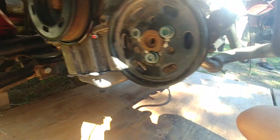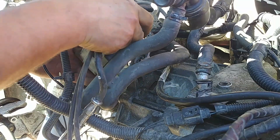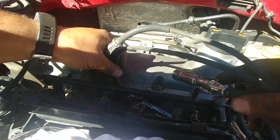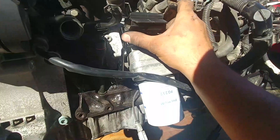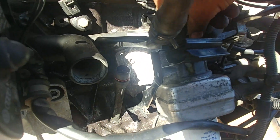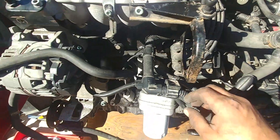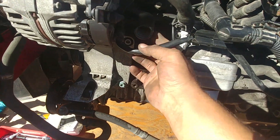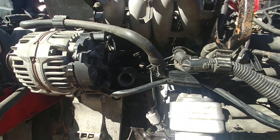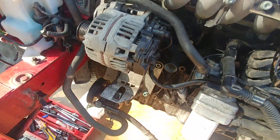This old Golf is a nice car — it's going to get a second life. Tie those bolts, nice and tight. Now time for the ignition module — there's no distributor on this engine, just coil pack ignition with plug wires. Make sure you're putting them in the proper place. There's a little plastic bracket on top of the oil filter housing for the alternator wire.